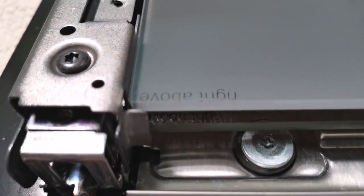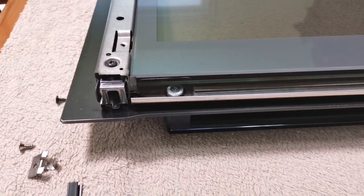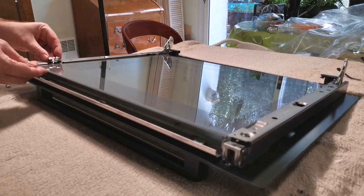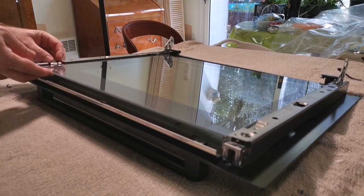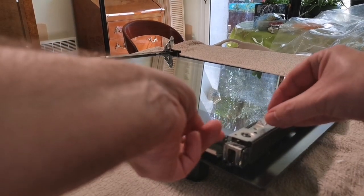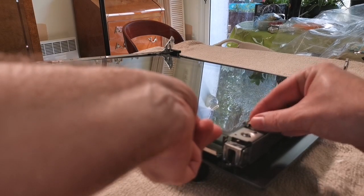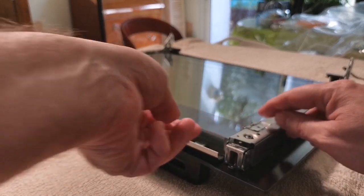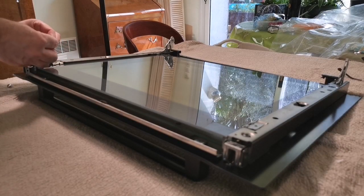You can see the text lines up on both of those pieces of glass with that top edge. Then we fasten the upper clips back on — just lift that piece of glass up, down over that hole there, and the same on this side, with the two lugs to the top. That just holds it steady, and that screws back in with the black Torx screw.